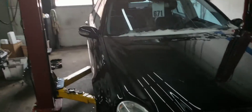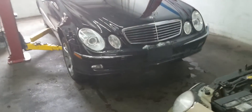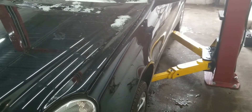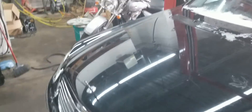Hello guys, this is Nabeel from Auto Repair Champs. Got an interesting one for you today — I've got a 2006 Mercedes-Benz E-Class, it's an E350. The problem with this vehicle: we got it from another shop. The customer replaced their transmission, it had a problem, they replaced the transmission, and the transmission they put in is not working. Whatever you do with the gear selector, it just does not shift any gears — you put it in neutral, park, drive, it's just like you're not doing anything.